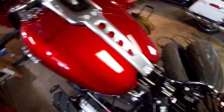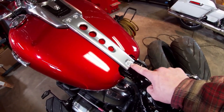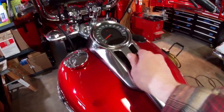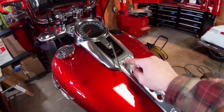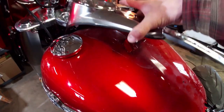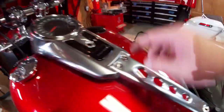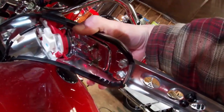To get the dash piece off, I pulled the seat off to access this screw — that's a 5/32 Allen. The other two screws are the same but have a nut on the back side, so you also need a 3/16 Allen to hold those. Take the whole dash assembly off and then separate the two pieces. It was really stuck down just because of the rubber seal — never been off before — so I had to wiggle and pull quite a bit.